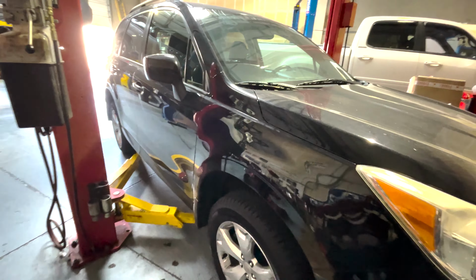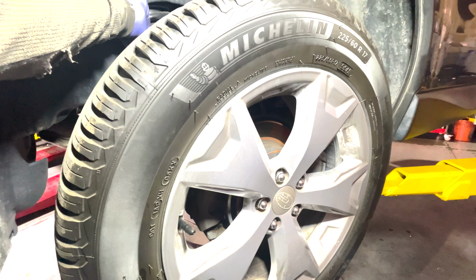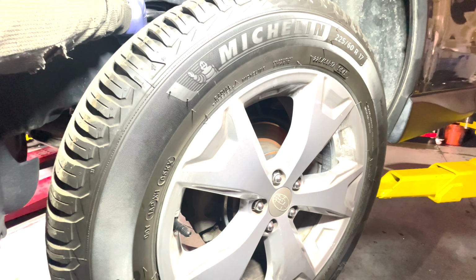So one way to find a worn wheel bearing is to hold on to the coiled spring and spin the wheel, and usually the vibration will transfer into the coil spring. And if it's completely smooth, then it's something else, or it's a different wheel.